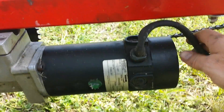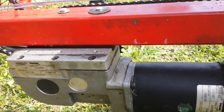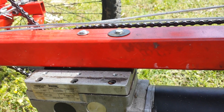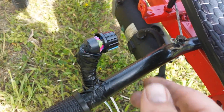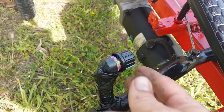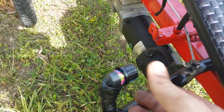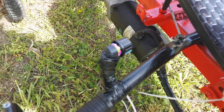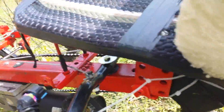You can see the electric coming off the motor, and this bolts nice and flat to the bottom of the frame. I made the holes a little bit bigger up there just so I can adjust the motor around and get the chain just right. Up here we put our control — this is off — and we turn it on for variable speed control. I'm going to try to work that into kind of like a throttle pedal with a spring return or something at a later time.